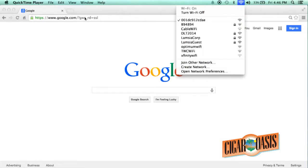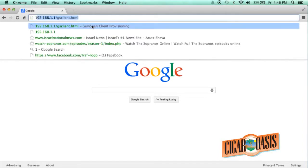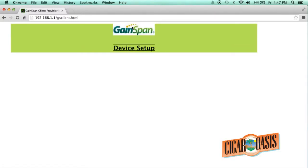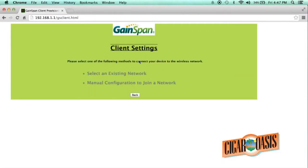to that network, you'll go to your address bar on your browser and type in the following URL, which is on your instruction manual or will be in the description of this video. So that's 192.168.1.1/gsclient.html. This URL will not work unless you are connected to the network, which is the MAC ID. Okay, once you reached here, refresh it, make sure you see wireless and network configuration. Select an existing network.